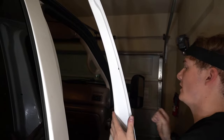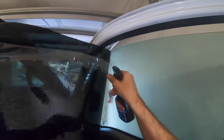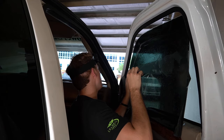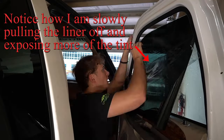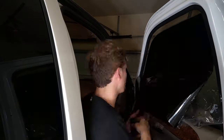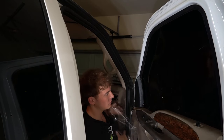Get it super wet here. Take our tint — the good thing about this method is you don't have to be as careful because I'm going to get it perfect. This is the part that has to be absolutely perfect. Work it a little bit here. When you get the top part on, as you can see there are very minimal wrinkles on the top with that film. You can squeegee down to get the wrinkles out — two different ways to do it. Basically just squeegee that entire top part out. Film is officially off. I'm going to squeegee it out, finish it up.